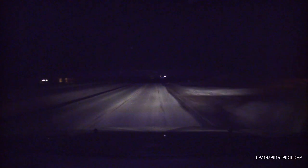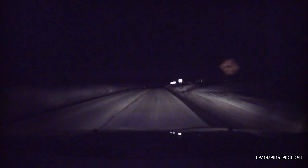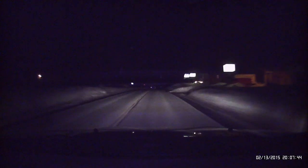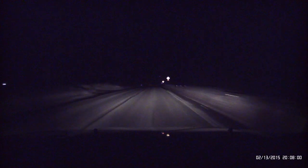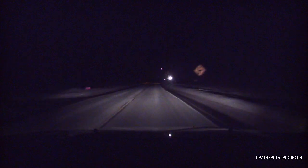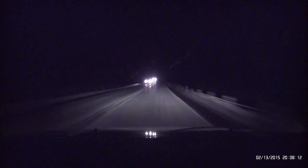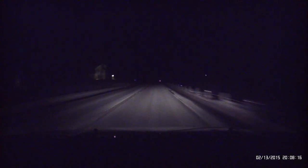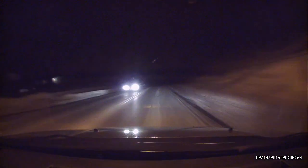With the night vision, as you can see I'm turning the LEDs on and off here and they're not doing anything to enhance the image during the nighttime shot. The only thing they're doing is lighting up my dashboard and reflecting on the back side of the windshield — so that particular feature doesn't do anything for this camera. Also, the darker portions of the image have a bluish/purplish speckled color mixed in — you're not getting true black color tones. But where the actual headlights are pointing you can see everything fine. It's basically what you want this to do. If you were at a light, had the right of way, and got into a car accident, you could definitely use the footage without any issue.